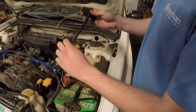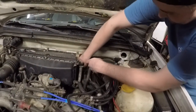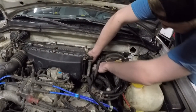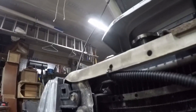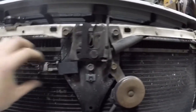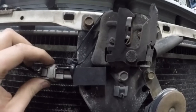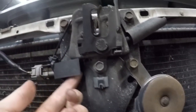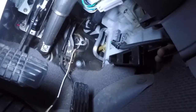Pull all the way through until you get to the weather pad plastic protection guard — shove your wire in there and then pop your grommet back on. To route the temperature sensor wire, we went back along the back firewall along the brake lines, up over here, tucked it in between the fender and the body, underneath the j-tube, then through the little hole in between the radiator and the core support. The bracket for the temperature sensor was broken, so we got creative with zip ties — it should be facing so the temperature sensor is exposed underneath.